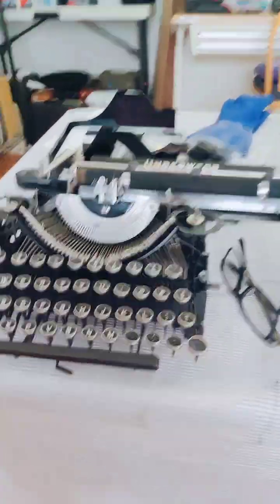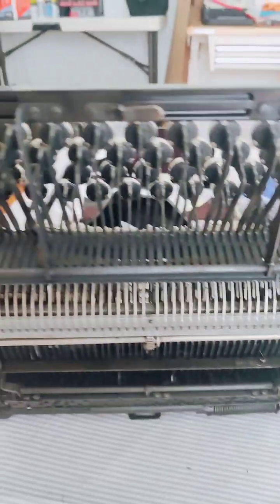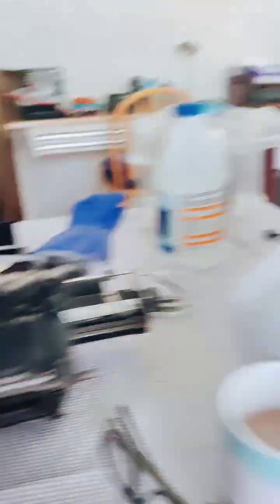That's a reasonable question, because the machine has to be disassembled and taken apart. The odor you're smelling is felt inside the machine that has mildewed or molded, so that would need to be removed and replaced. Also, there are lots of intricate moving parts, and often in a machine that is 100 years old, things like the drawband — made of cloth and under tension for the last 100 years — and the platen, the rubber piece that rotates, may need to be replaced, along with some rollers. The process involves disassembling the machine, cleaning with an industrial degreaser that's paint safe, removing rust, applying an anti-corrosive layer, and ensuring all intricate moving pieces are cleaned. Then a 20-gallon air compressor is used and the machine is reassembled.